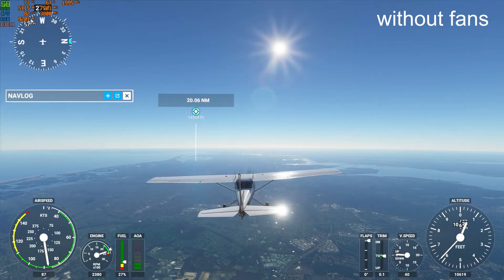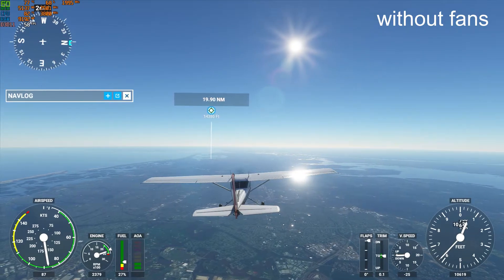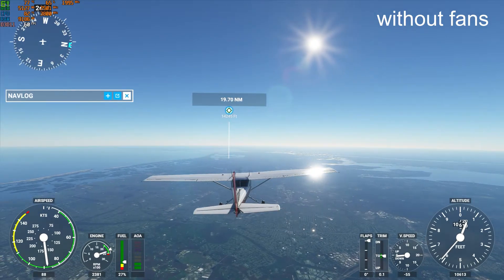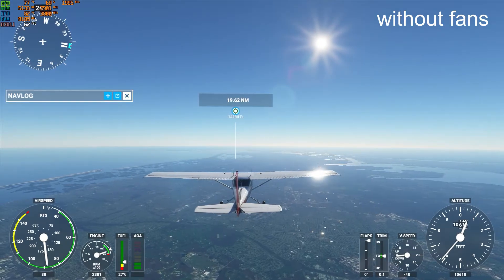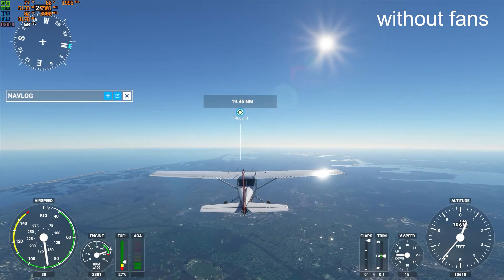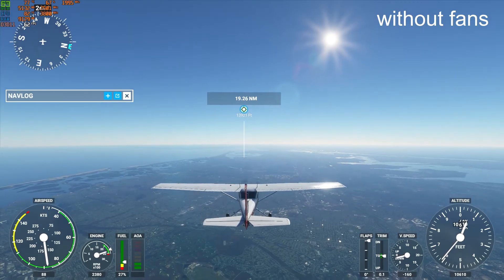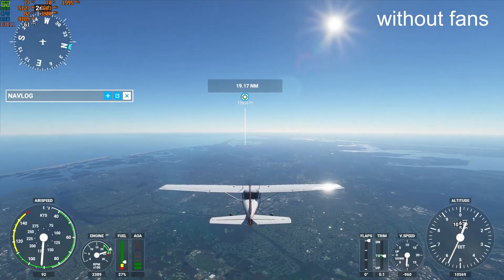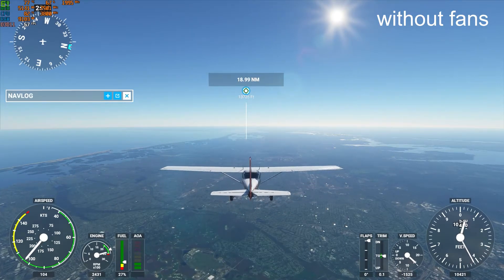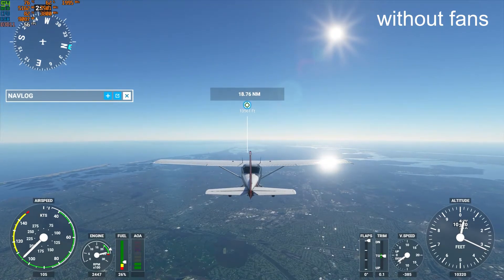In this video I'm going to be focusing pretty much only on the CPU's temperature, because the GPU is not really in the path of the case fans anyway. I was definitely not expecting the temperatures to be this much higher than what I'm used to. I'm not exactly sure how much it normally is, but usually I only use one 120mm exhaust fan. I never measured it with only the 120mm, but I don't recall ever seeing it hit 84 in a game without an overclock.